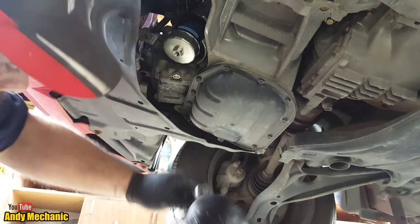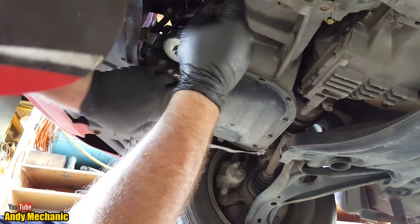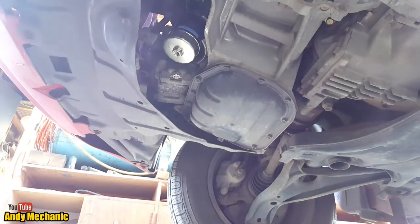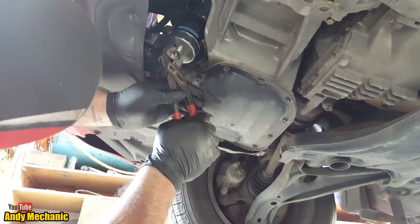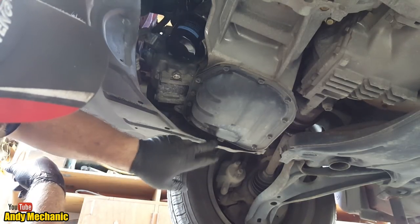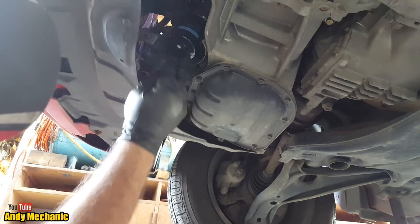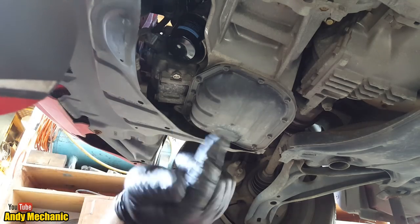Okay, so next job is to remove the tool for fitting the filter. Big pair of pliers, I reckon. These are always a pain to get off. There we go. Perfect. Right, sump bung's in, that's torqued up. Oil filter's in, that's basically set to the right torque. All we need now is some oil in the engine, so we need to go topside.